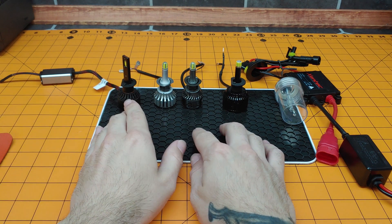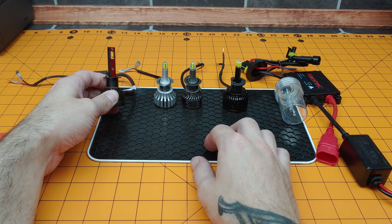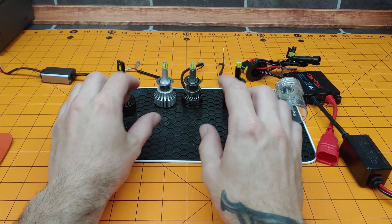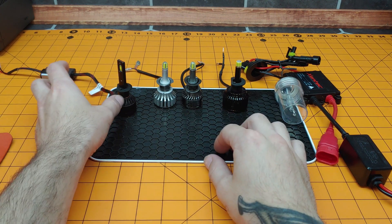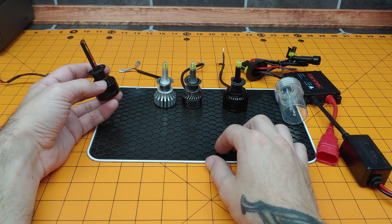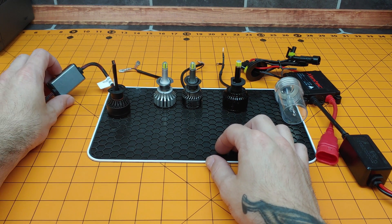I'll put a link to the individual video reviews for each of these bulbs in the description below. This one did surprisingly well — I normally have a bit of disdain for dual-sided LED headlight bulbs, but as we saw, it was only using 33 watts and had the overall brightest upper level and a fairly decent bottom row of brightness. The issue I have with this particular bulb is the heat sinking just doesn't feel adequate. After a long time it does start to feel rather warm, so we'll have to see how the longevity holds up. The control box also gets very warm.